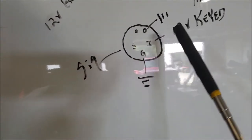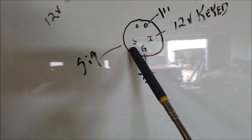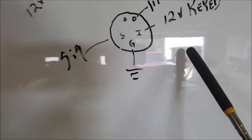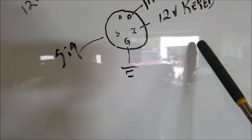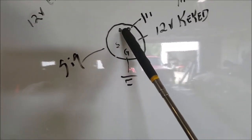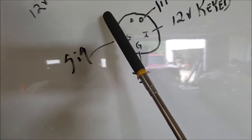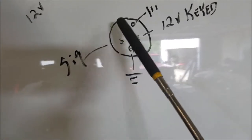Now all four of them are set up the same way, except for the voltage, which doesn't have a signal coming in. All you do is take the 12 volt keyed, put it in your fuse box, in a fused, and that should work. And then, you know, set up the light the same way, the ground, and the red wire goes to your courtesy lights or whatever. Yeah, I think it's courtesy lights. Like, you turn your lights on and you're driving down the road at night.